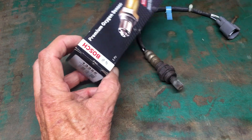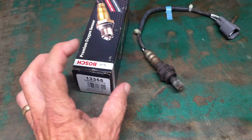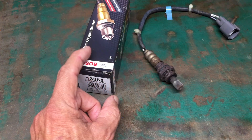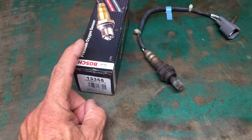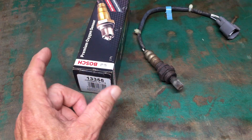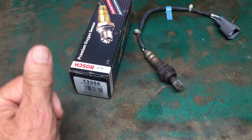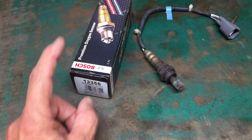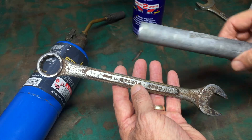Down in the description I'll put a link to the Bosch sensor I used — it was $133.55 list, and I paid $104 at AutoZone because they're three quarters of a mile away and had it in stock. The same sensor is on Amazon for about $50, but sometimes you pay for convenience: if it fails within a year I just drive down the road. For the upstream sensor one — the one accessible from the engine compartment — I do not know if this Bosch part fits that location on the 2AR-FE. For bank one sensor two on this 2011 RAV4 four-cylinder, it was a perfect fit.